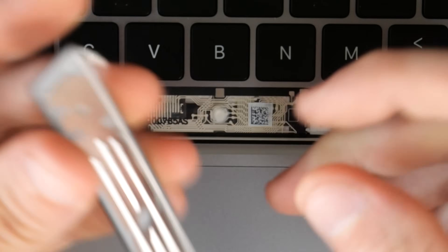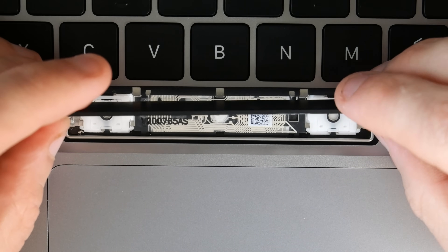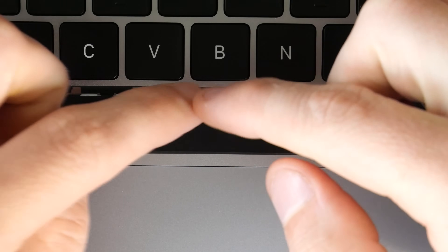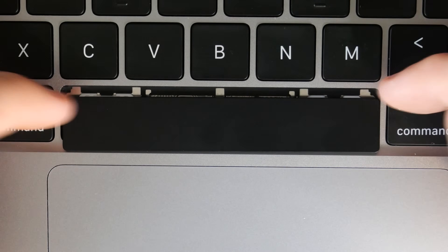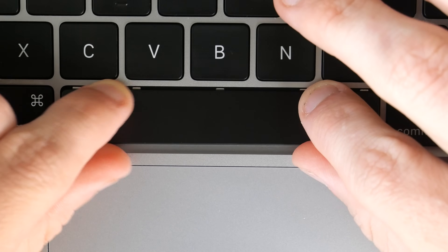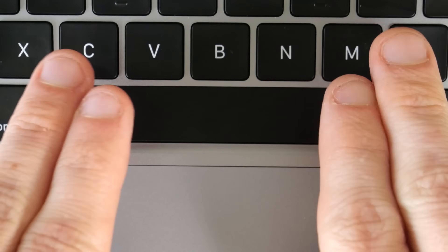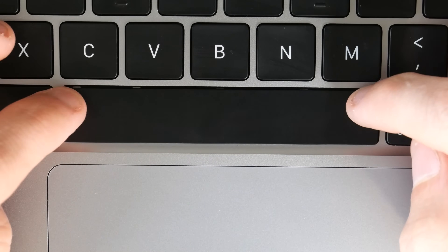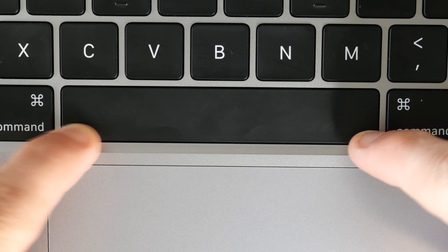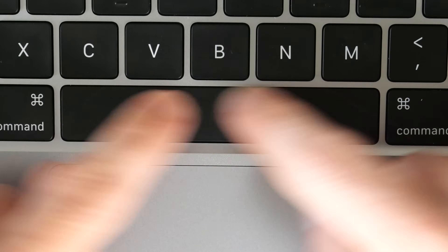Rotate the little feet out and slide them into the little notch. Pull the key down towards you a little bit, press down slightly into the middle sections, then push the key away from you — that lodges the four awning clips in place. Then press down on the bottom of the key to clip it into the bottom lobster clips and the bottom support bar. Your space bar should now be reinstalled and pressing perfectly fine.